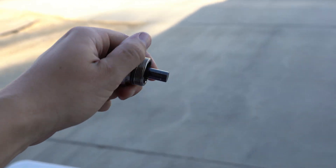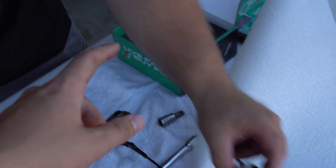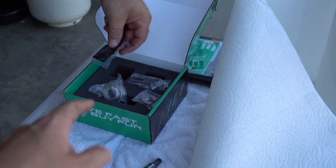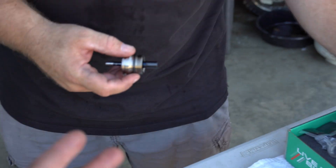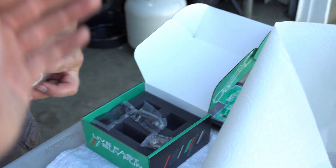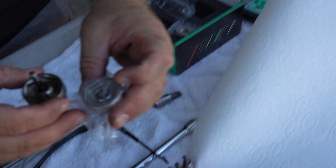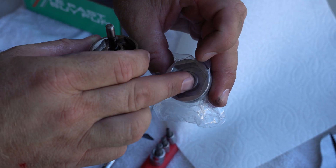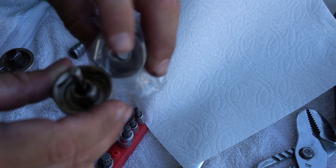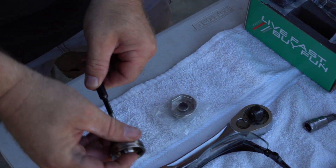You can see the old piece has a special coating that's been worn through. What makes this an upgrade is a tighter tolerance, so it builds more pressure - which is what the high pressure fuel pump is supposed to do. The stock one has its limits; this IE unit has up to 35% more flow due to precision machining and a bigger shaft diameter - you can clearly see the difference in the inner diameter between old and new.